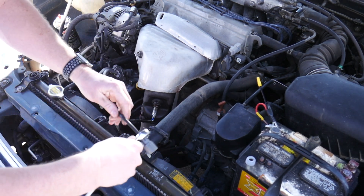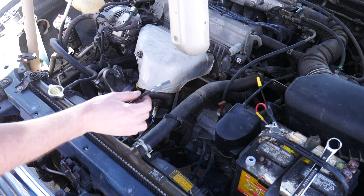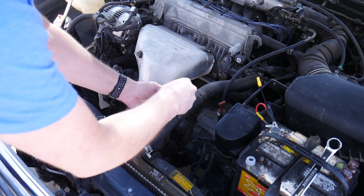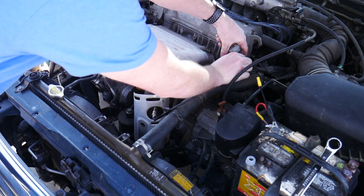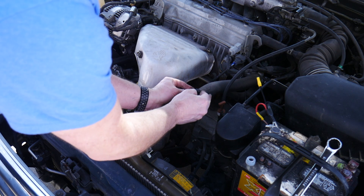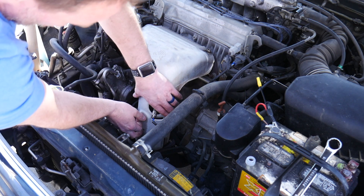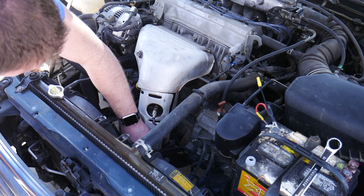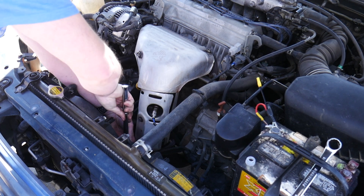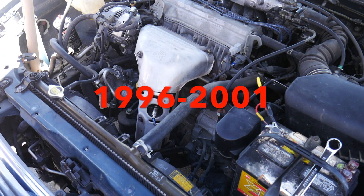Cinched that down pretty good. Don't forget to put your heat shield back on — you have to feed that through there first before you get all excited to plug it in and test this out. It snapped in place. Put the clamp back on that holds it out of the way. Tighten these down good or you'll end up with a rattle — there are just two of them. Those don't have to be super tight, just snug them up. And that's how you replace the front oxygen sensor on a 2000 Toyota Camry.